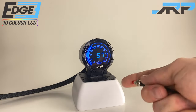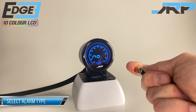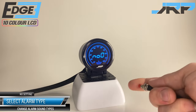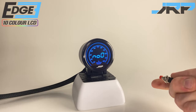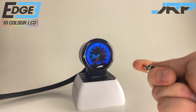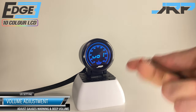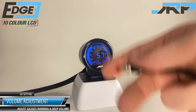Now we'll scroll to the fourth option in the menu displayed as NO. A long press gets us into the menu and we can change the alarm type we want to hear when the gauge enters a danger zone. As we progress through the list we can hear the increasing urgency — until it's too late. Sorry eardrums. Once you've recovered, set your final desired volume by scrolling to the fifth option again. It's best to do this while the engine's running or even with your helmet on — you know, because race car — so you can decide what level of punishment your ears deserve in the danger zone.